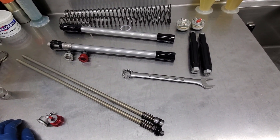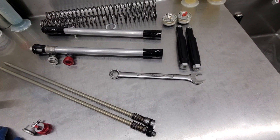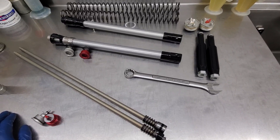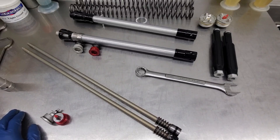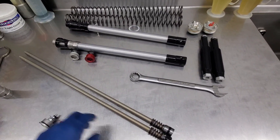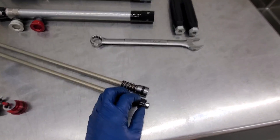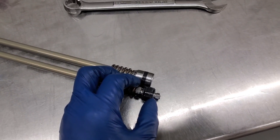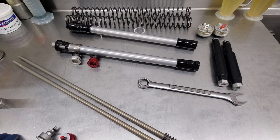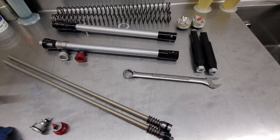But if you're doing Enduro or any higher speed stuff, it absolutely will not work — you're going to have to resort to aftermarket stuff: Ohlins, WP cartridge kits. There is a bit of a conversion you can do on these to turn it back to a fully functional symmetrical style, with the old-school adjustable base valves, where you actually replace this mechanical piston with a truly full-functioning compression and rebound side — so both forks function just like your 2016 and prior KTM open chamber fork. That's a great cost-effective way to do it, and then the inserts go up from there — nine to fifteen hundred dollars and up.